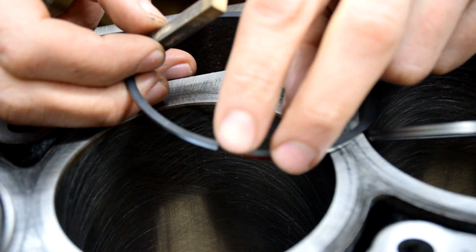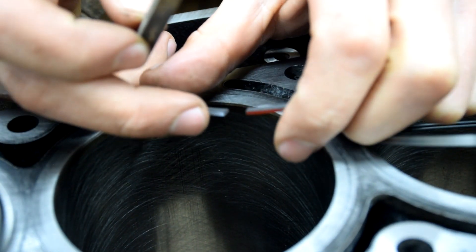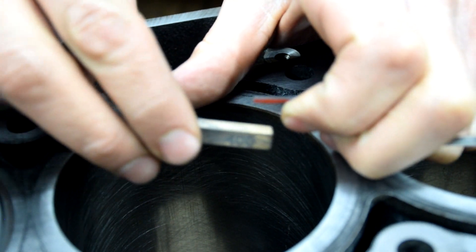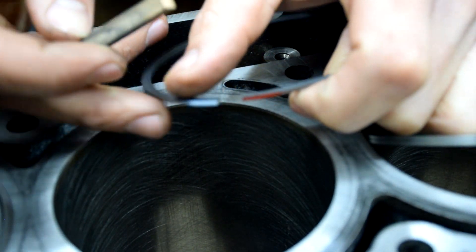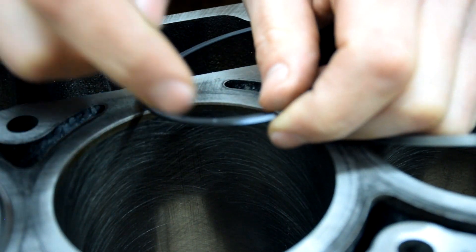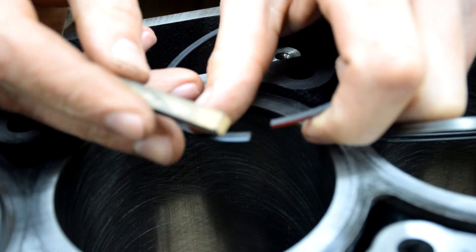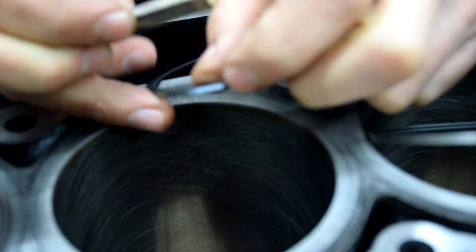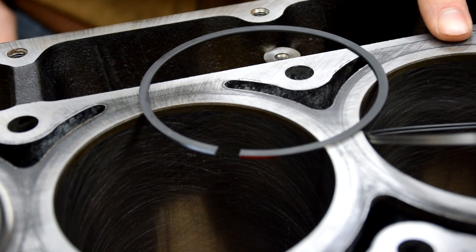Here's the ring that's freshly filed. What I'm going to do here — on the top ring, what I should have done was just go like this with the stone, probably not over your motor of course, for demonstration purposes only. It's kind of going to look like a chamfer, but you don't really want to put a chamfer on there. As long as you can't take your fingernail and get it caught, you should be fine. Do the other edge, then the other edges are just like the second ring.